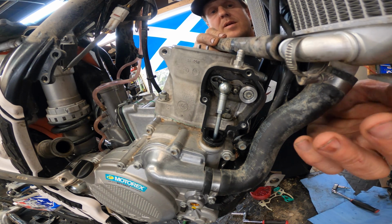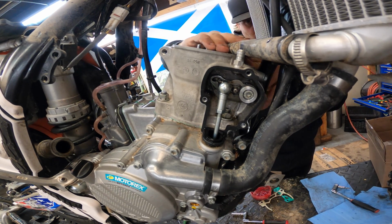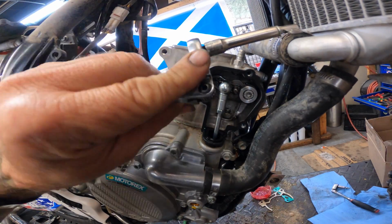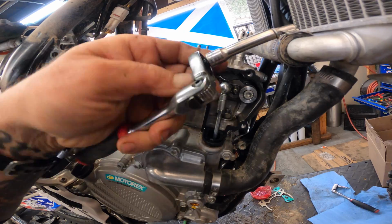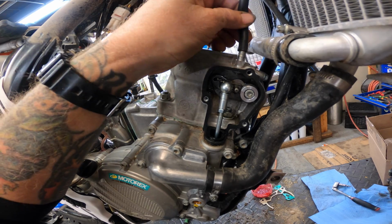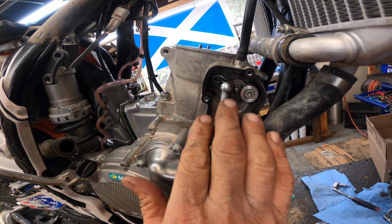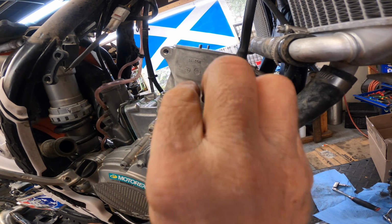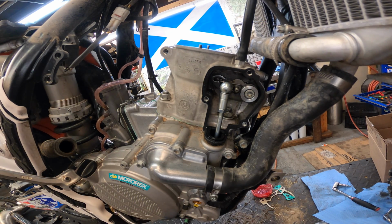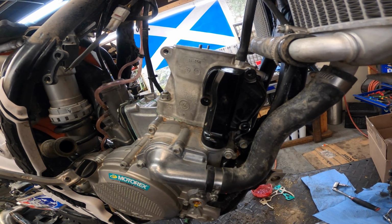radiator hose back on. Now, vent hose back on. Oh, also guys, just so you know, this is a vent for the power valve. If you don't have a vent, it will build up pressure right in here because of all the moving parts and heat and all that stuff. So, got to make sure that's vented. All right, 3-bond is cured enough now.